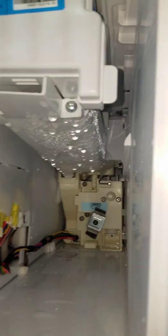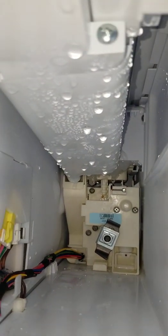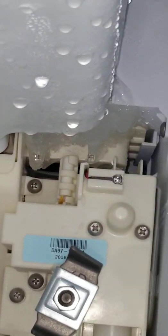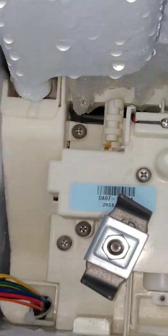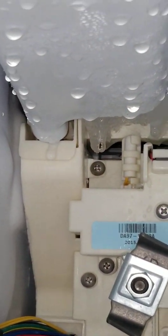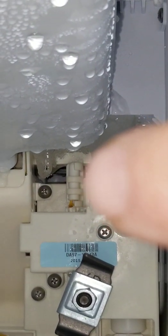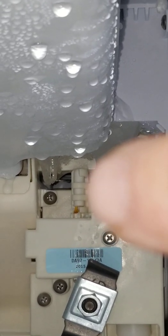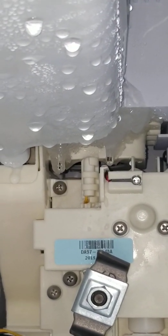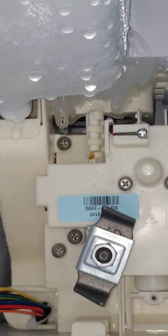At the same time, we're having an issue with the ice maker — a common Samsung problem. Going to the back, you can see there's a lot of ice buildup back there that prevents the fan right in that area from running as well. Once the fan stops turning, there's a thermistor right at the edge of my finger there, and right behind that thermistor, above that screw, there's a fan that's also obstructed with ice and can't turn. We'll fix all that.